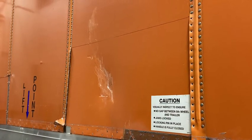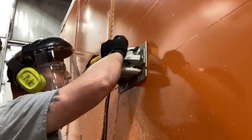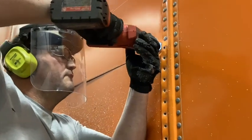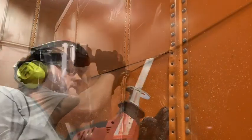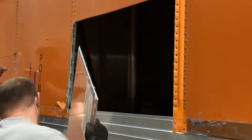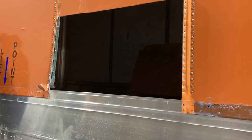Now that you've got your panel marked, you're ready to cut — using a circular saw or a sawzall will help with this. I wanted to take a minute while Josh is doing the cutting to mention that this is a two-piece high-base rail system on this trailer, and we did have to do a high-base rail section. I did not have the chance to include in the video removing the rivets of the high-base rail, which is something you're more than likely going to have to do when doing a panel section. Here's the panel being removed — take care to not cut deeply into the posts. You may nick them a little bit, but you just don't want to cut them in half.